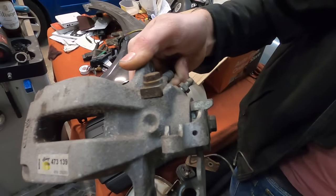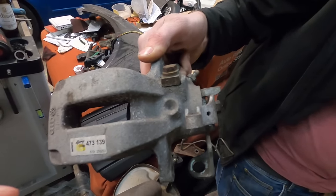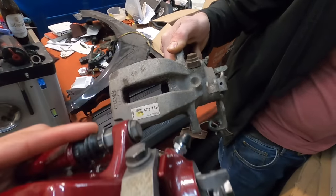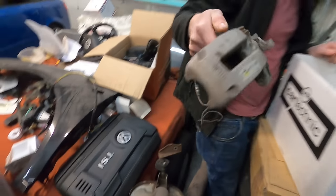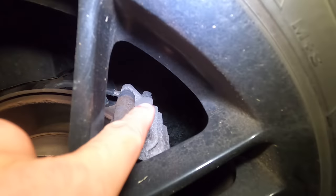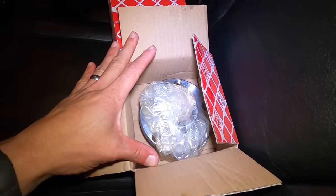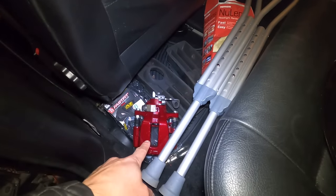The key difference piece — I may not even need it since it's already on the car. I can just swap from my car. I also have the four-motion brake line just in case, but looking at my car now I can see the brake line routing in the back — it should go to the top, I just take this piece off and we should be good. So we've got new shields for the back, new wheel bearings for the back, and I now have the information on how my brake lines need to go. I also have the spacers needed for these calipers.